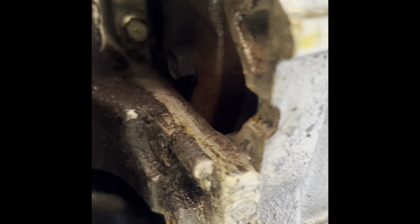There's one of them. And once you remove that bolt, the way you move the engine is with a ratchet in the front of the engine, ratchet in the socket on the bolt of the crankshaft pulley, or the, what's it called, the harmonic balancer. And look, I'm gonna go ahead and move this and you're gonna see that move. See how it moves? There you go. So once I remove that bolt, I'm gonna have to continue moving till the next one, just like this. It's gonna wanna fight you because of the compression of the engine. Once you have it lined up, then you remove the bolt.